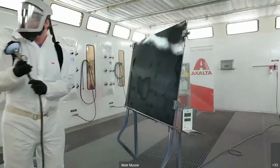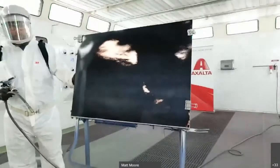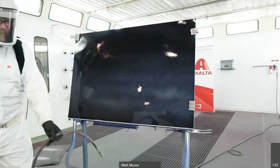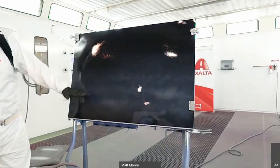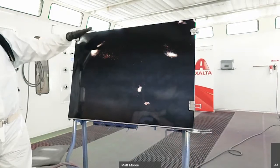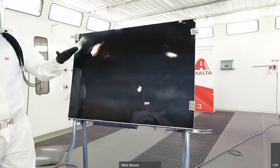What you're seeing now — and I'll try to turn this a little bit — you can see the bottom is cloudy. It shows much more cloudy in person, but you can see the contrast from a correctly applied wet bed to an incorrectly applied wet bed. Way too wet, too milky. We want to go close and fast; by doing that we achieve a nice uniform closed coat that's wet enough to accept our overspray. It should be pretty much clear — a little milkiness is normal — but you don't want to overload the wet bed.